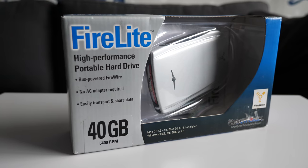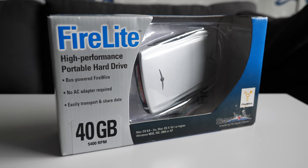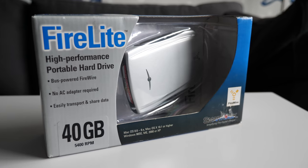I went out and picked up one of these. This is a portable FireWire hard drive. It's basically an IDE laptop drive with a FireWire bridge board on the back. It's bus powered, so you only need to hook one cable up to it. And the most important thing is that FireWire is bootable on these older PowerPC-based Macs. To make a bootable OS X installer off of one of these drives, we're gonna use a built-in tool. We'll get to that in a second.